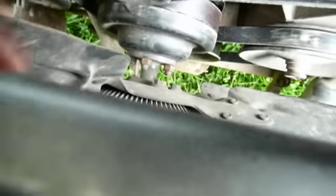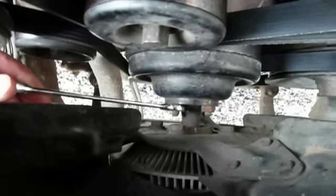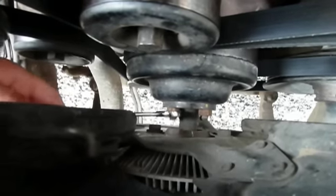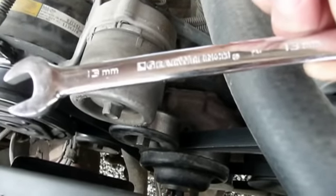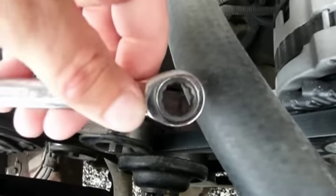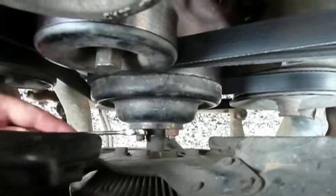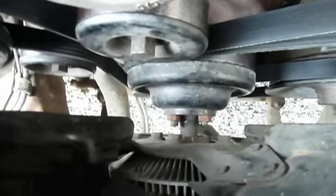The only thing I've got to do now is tighten up my fan bolts to the water pump pulley, because those came loose yesterday when the belt came off. To tighten your water pump pulley studs or nuts, I'm using a 13mm GearWrench box end wrench with a ratcheting end. All you do is come down here and get on it — you don't want them killing tight, just fairly snug.